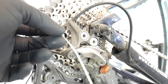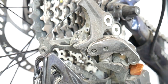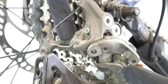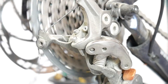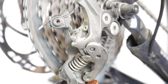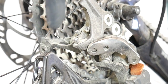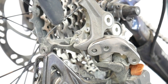Now how can we snap the cable on our bike? This is the cable and this is the small bolt that is assembling the cable to the arm of my rear derailleur. Please note what's happening while I'm changing the gears — can you see that the cable bends? Yes, its shape changes right here. Of course different derailleurs will have different routing, and sometimes it bends even more, which is how we can break the cable.